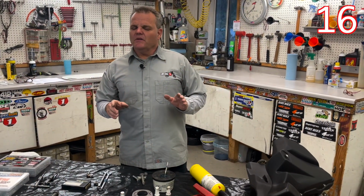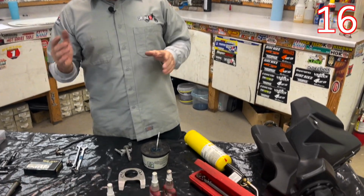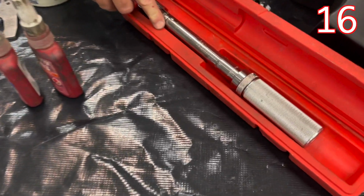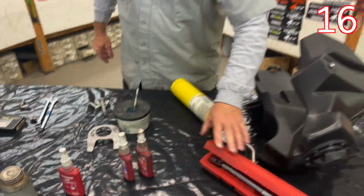Okay, so if you're not familiar with the good feel of bolts, a torque spec is very important. You can look up the torque specs in your manual or online. KTM manuals online has them for all of them, and if you don't have your book, you can search it and find out the torque specs for important matters so you don't break off bolts. That's one of the common things as guys are getting into the sport and learning, working on their bike. So you want to have a good torque wrench that you can set.